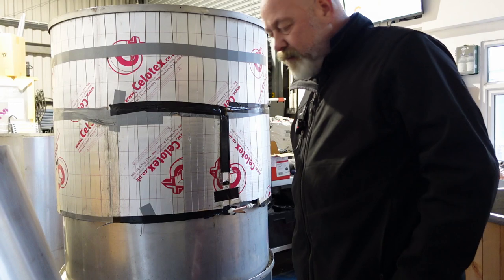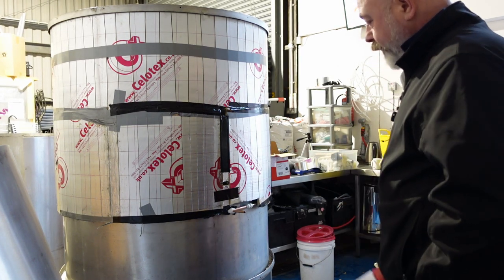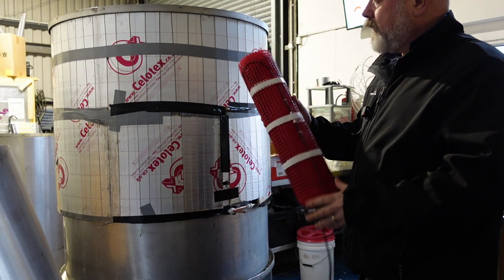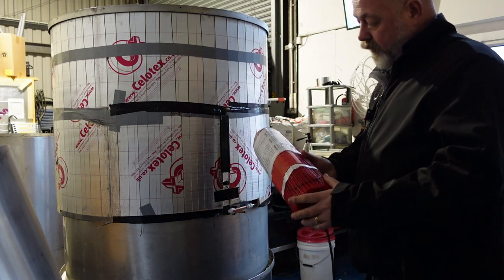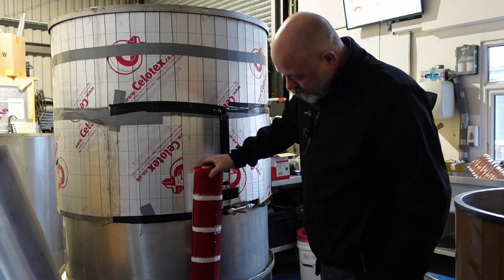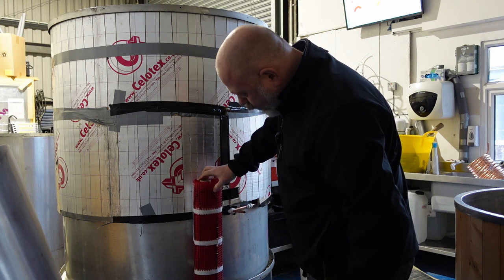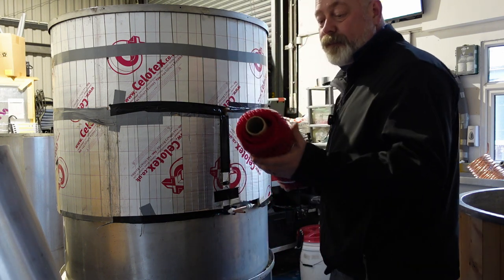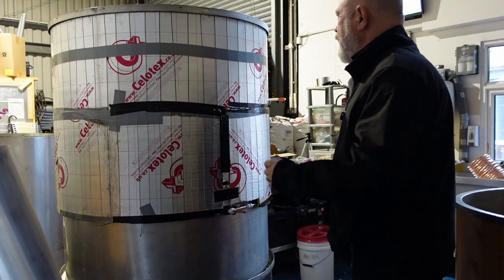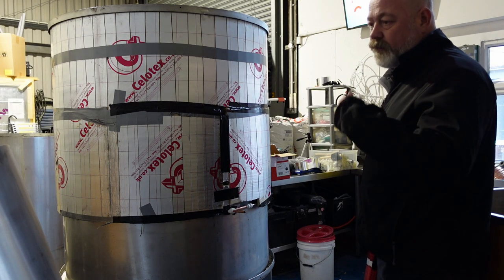Fast forward an hour or so. I was going to put it all back together and I thought — let's get the front cover off as well, which was heavy and dangerous and I shouldn't have done it on my own, but I did. We've stripped off all the insulation board around the bottom half of the tank. Now from Tool Station I've got two square metres of underfloor heating wire on a backing. I was hoping it would fit just stuck on, but it's a bit too tall and going to impede the pipes under there. So I'm going to take it off the backing like last time and tape it to the tank. I've also ordered the 5mm stainless steel rivets — we don't want aluminium rivets in a stainless steel tank if we can avoid it. They'll be coming tomorrow from Amazon, then we can get the covers back on and get the tank back in the corner.